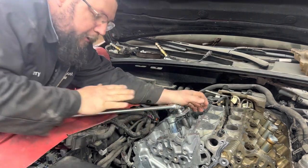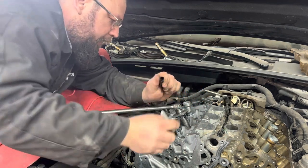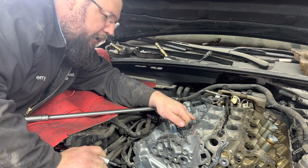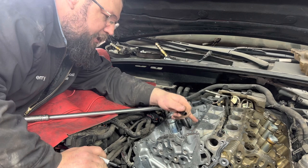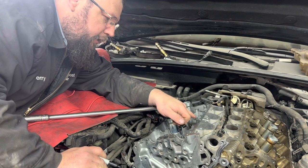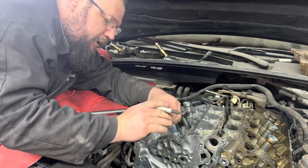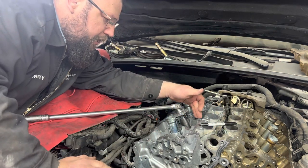Right now, first thing you do when you get to your torque angle — you take a Sharpie and put a mark on the head to tell you you've done this one. Because if you lose track you're screwed — you don't know what the torque is. If it's just a regular torque you can double-check with your torque wrench, but when you've done the angle and you miss one, yeah, you're going to have a bad day. This is why you take a Sharpie, have it ready, and put a mark near the bolt that you've just done.